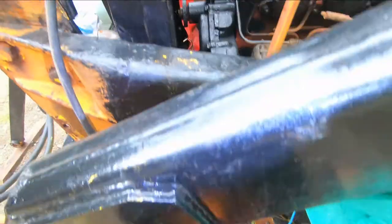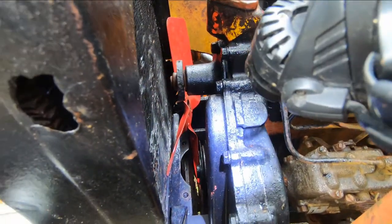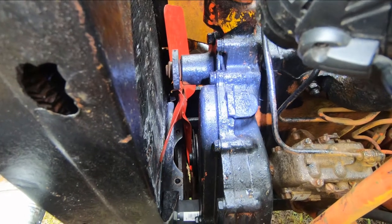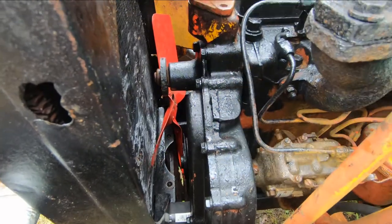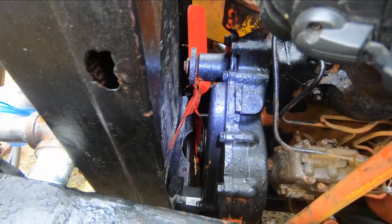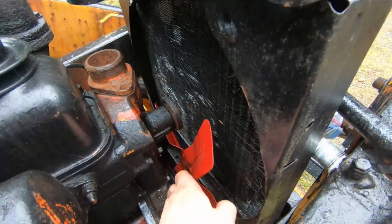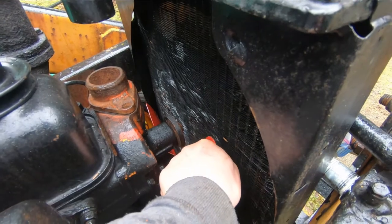Let's take a look up top here. As I was doing that, the fan has got to be in there somewhere, so I was making sure the fan's not digging into the rad anywhere. I'm going to bring it back up onto the pulley, put the pulley back on, and sit the fan in place before I sit the rad right back down where it has to bolt in.